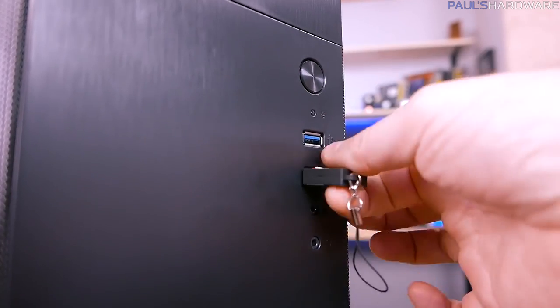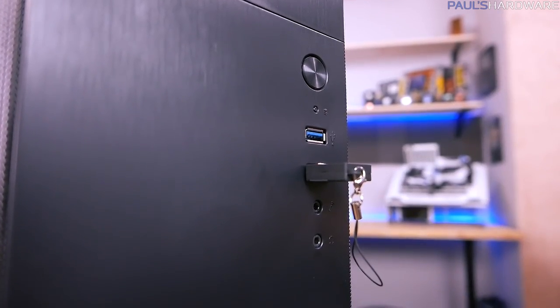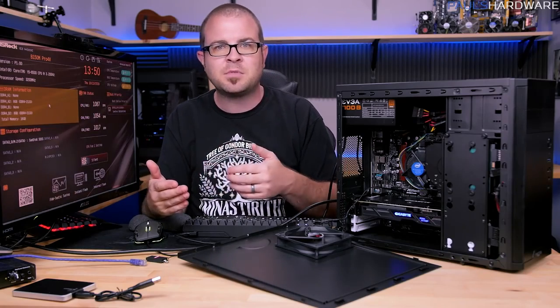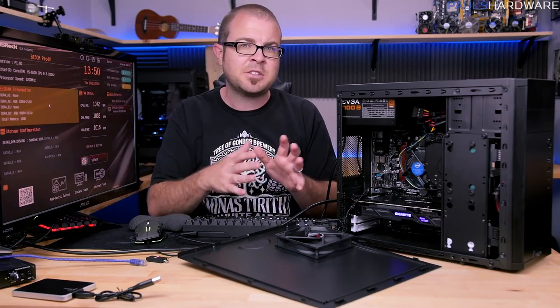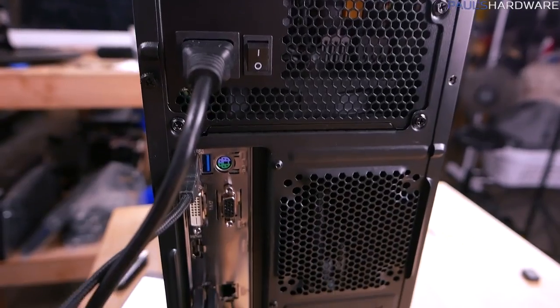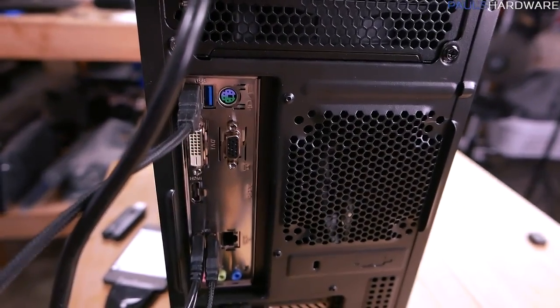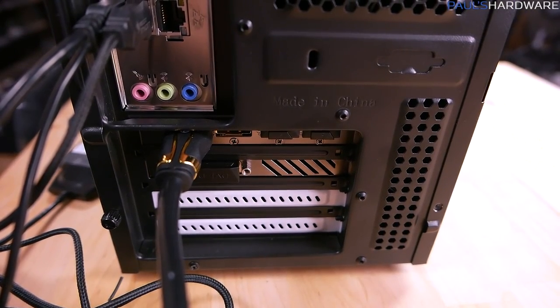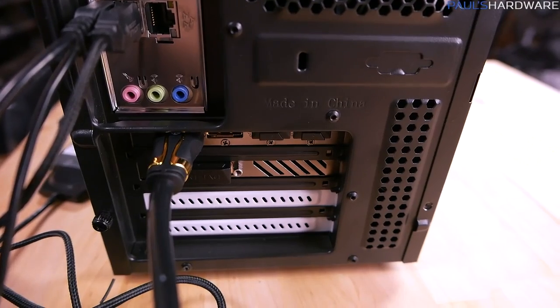If you have drives plugged into there, they should show up here in the BIOS as well. And then there's other stuff that you might check as you go on further through the installation process, and definitely make sure you have checked everything by the time you got Windows up and running, which would also include all these ports on the back panel, so the other USB ports back here. I have currently plugged in the monitor via the HDMI plug on the graphics card down here at the bottom.